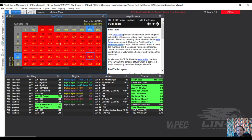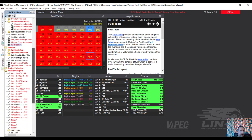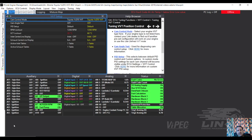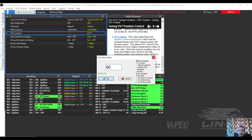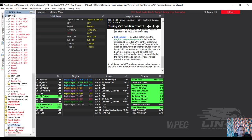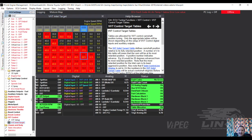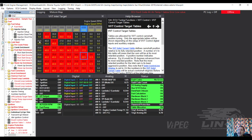I can whip through and change some numbers in the cold start tables, but that's not really my main focus right now. My main focus is why our fuel tables are so different - that's the main concern. I'm happy enough with the timing maps. Looking at VVTi control down here - this one's got a lockout at 20, mine is at 60. He didn't notice something funny there - we're going to change that, bring the lockout up to 60. The target numbers are a little bit different but I'm not too concerned about that at this stage.